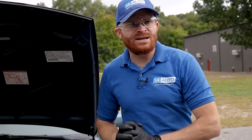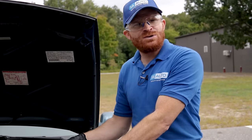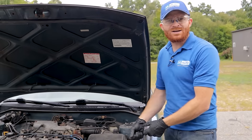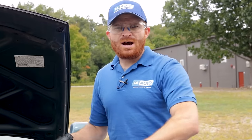It's a good idea to immediately take your vehicle for a road test after jumpstarting, so the alternator can do its job for an extended period and charge up the battery. As for revving the engine on the good vehicle — it's not necessarily going to be helpful. We're jumpstarting, not charging the battery. The alternator will put out a little more amperage if you rev, but it won't meaningfully help the jumpstart, because all the power for starting comes from the battery, not the alternator.